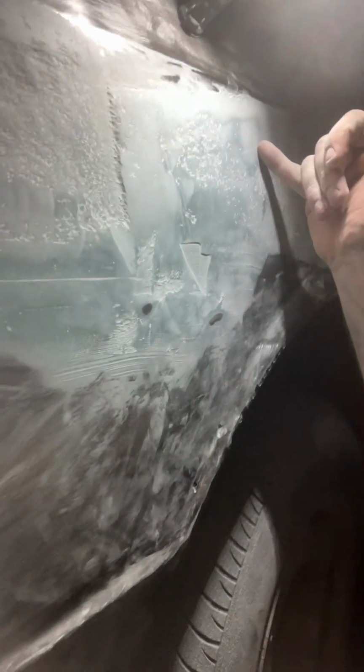But I'm going to see how smooth this is right here. I bet money says if you had a laser, you could laser this spot right here to this spot right here, and I bet they'd be perfectly even. So then after I clean these divots out and get all the sand knocked out of them, I'll come back with the short hair strand Bondo. Trying to use all the same Bondo, or I'll probably end up using Bondo jelly because it can get in these holes a little bit better. And then I'll self-etch and primer it.